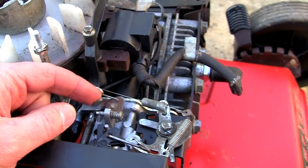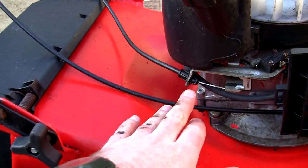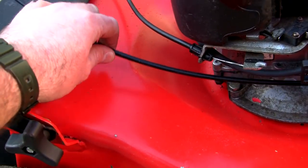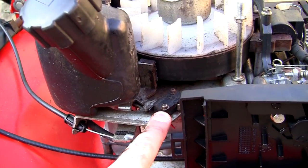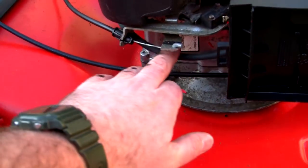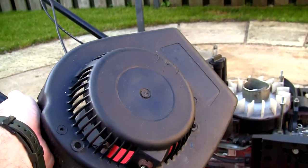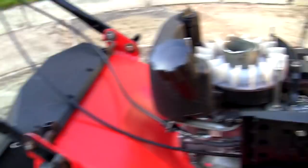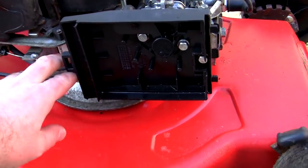One thing I see a lot, which really sounds obvious: these two cables here — I've seen these tied together, cable-tied together, or one routed around the back of the other. If this one gets obstructed, you won't get the correct throttle and the choke won't open. If this one gets obstructed, there's a good chance the micro switch won't operate either. Another thing I don't like on these: although it doesn't have the diaphragm and gasket setup, it actually has this plastic tank on the back. If you see one of these SV150s with the actual petrol tank built into the back of this starter recoil, there's a good chance it'll be split and will leak fuel.